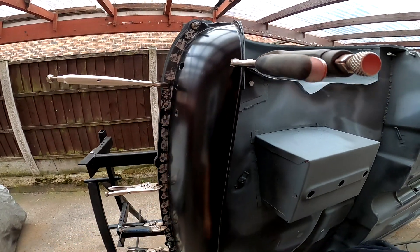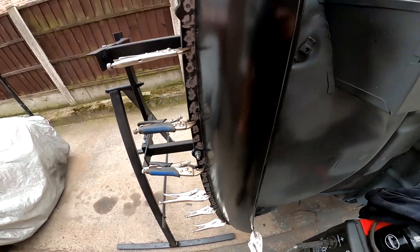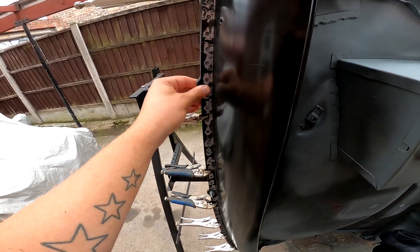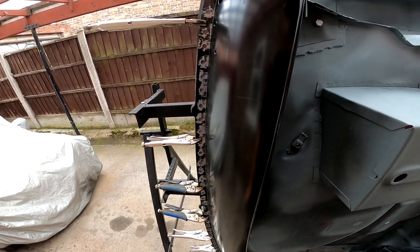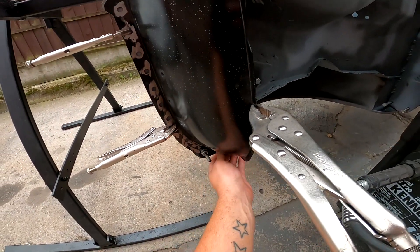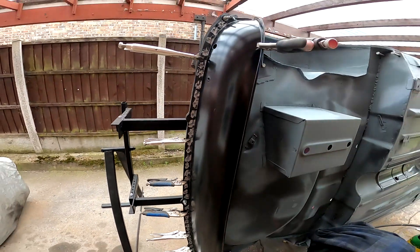Here's the next day. Like you saw on that last slide, this is all clamped in and ready to go - it's actually rock solid with the amount of clamps I've got on it. Everything's prepped. There's zinc primer between both these surfaces - a weld-through primer. I think we are ready to get going. It fits as best as it's going to fit. We'll get going - quite happy with that. So let's get the welder out and do a load of plug welds.